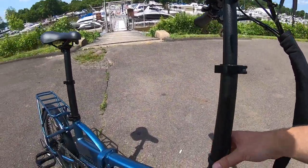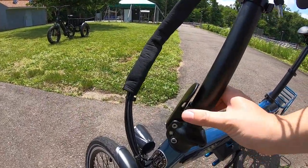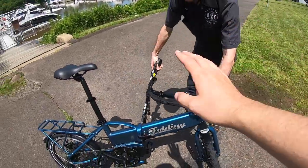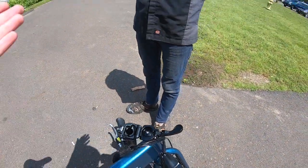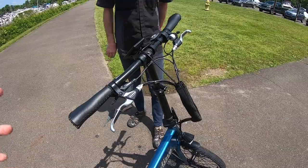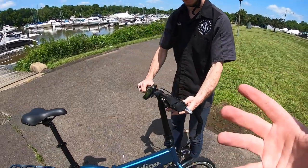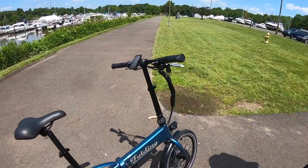The stem has a lever and a locking mechanism. There's a little ring you unlatch that allows the locking lever to come out. You open that lever and the whole handlebar system flops over — it's screwed into place inside the headset. When you pull it back over, it goes right into position, you lock it in, put the safety latch, and you're good to go. It also telescopes: open the collar and the handlebars telescope up or down depending on rider size, and these adjustments can be done on the fly.